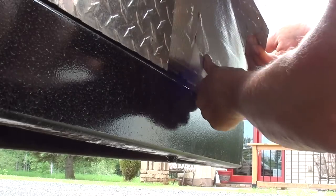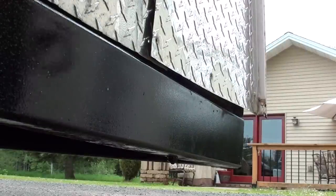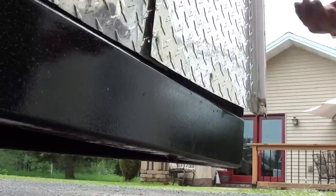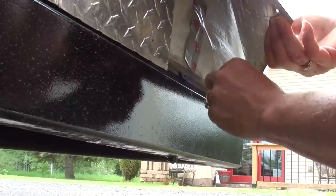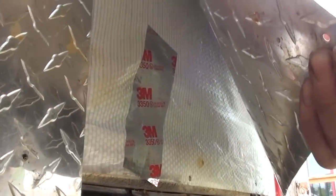So this little cut that you make in the tie-back — I just used a little bit of metal foil tape. You could use duct tape or probably even packaging tape, whatever. But I use this 3M metalized foil tape — it's meant for duct work and it's got a super aggressive adhesive on it. So I'll just take a little piece of that. The trick is to get it to stick to the tie-back more than your finger. Just close it up like that. That's how it should look. So there we go. Hopefully you found that helpful. Thanks for watching.